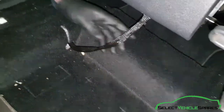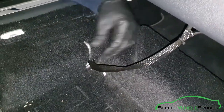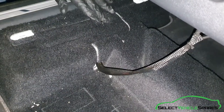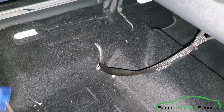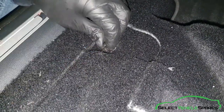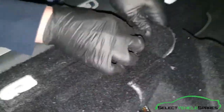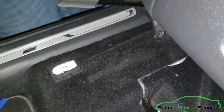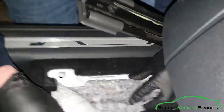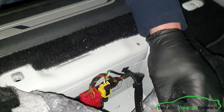Now we can tip the seat back — don't tip it too far back so that you put any stress or strain onto the cable. The plugs are under here, so you've got to move the seat back and tip the rail up first to get access. There's a small plastic clip in there — use a trim tool to just pop the centre up, that'll pull out, then pull the rest of the clip out using the carpet, fold that back and you can see where the cable runs in.